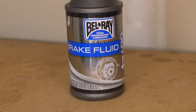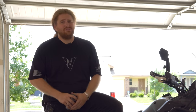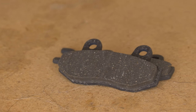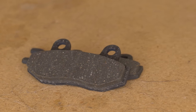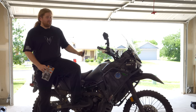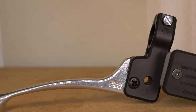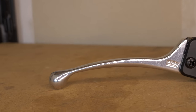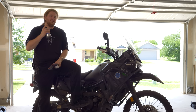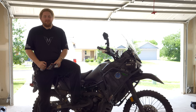You could start by bleeding your brake fluid — adding some better quality brake fluid than what's in the master cylinder could give you better results. You could also go ahead and add new pads; bedding down a new set of pads can improve your feeling at the lever. Then there's the nuclear option: putting a brand new master cylinder on your motorcycle. Each one of these increases in price and complexity, and we're going to test all three individually to see which one is the key to improving front brake feel.